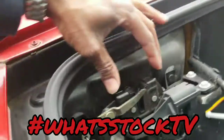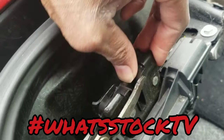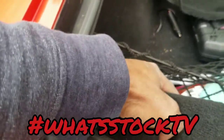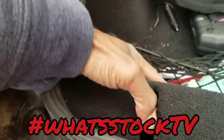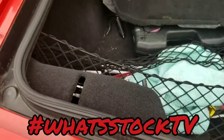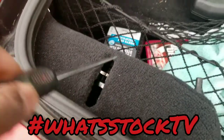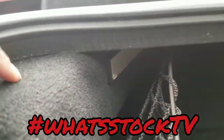What I did earlier was press down on the latch — you can do this with door handles, doors, even windows on Mustangs and Challengers, anything with indexing windows. It simulates that the door or trunk is actually closed when it isn't. Just like that, the light is off.